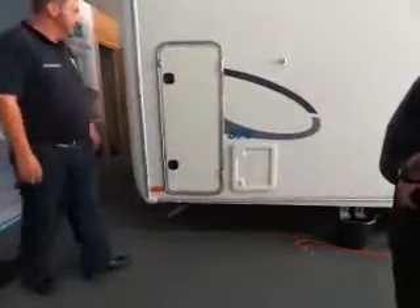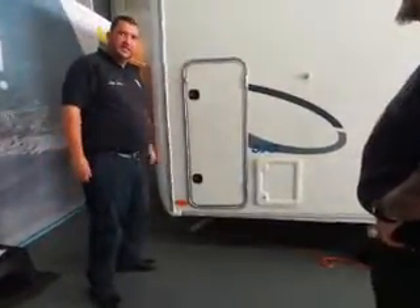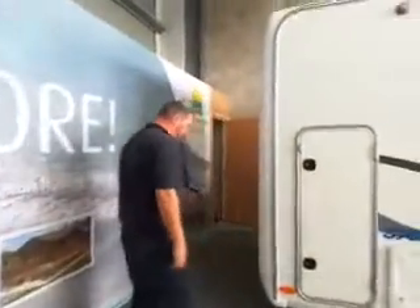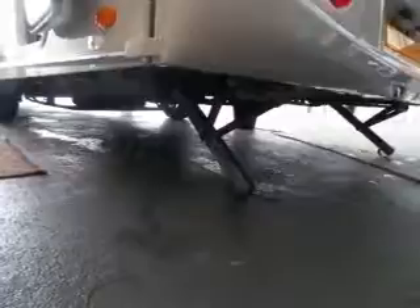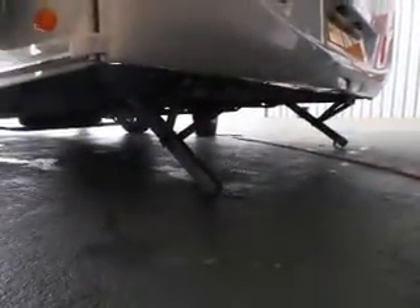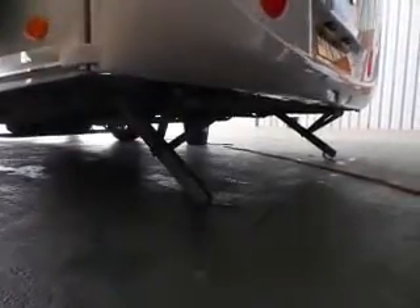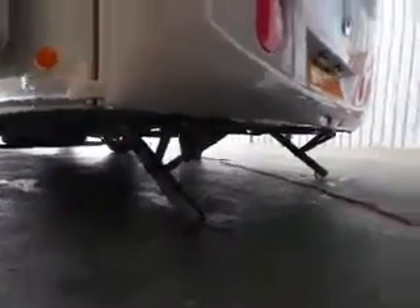So your next value is a whopping cupboard and that just leads into where your bunk beds are - I'll show you the rest of the hatch from the inside. Round the back - your two rear legs are on the back end, underneath the bottom there. They're bolted, and the nuts on the end to do them are just situated underneath there. We do use a drill with an attachment on to wind them up and down. If you tend to move around a lot I would recommend the drill because it takes you seconds to wind them down rather than minutes.